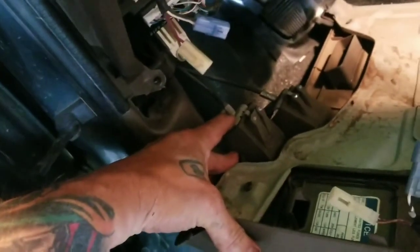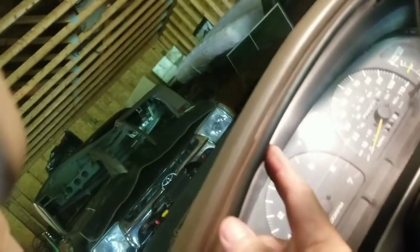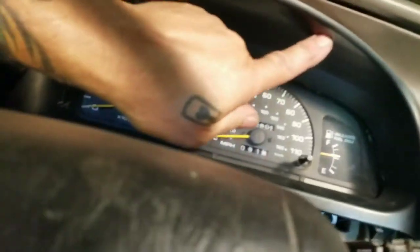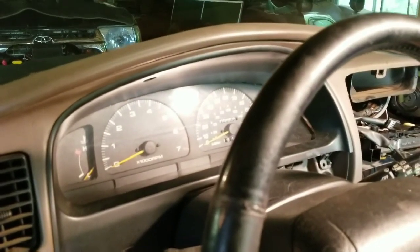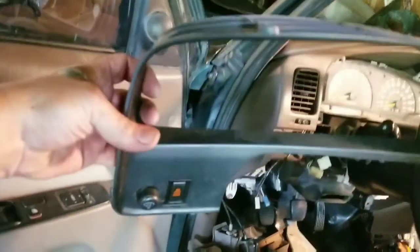This one I'll leave hooked up — the hood latch and the fuel door. I've got some screws to take out on this piece: two up in the top and one down here. That piece just pulls out too. There's another screw for the black bezel — let me take those out and then we'll take the bezel out. The long shank screwdriver really comes in handy here. With the tilt wheel in the down position, this just pulls forward from the top and lifts out. Don't forget to unplug your rear diff lock switch.